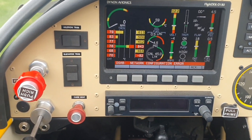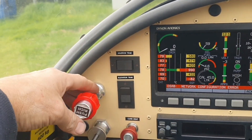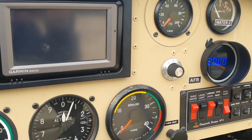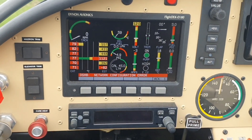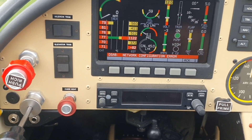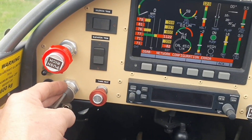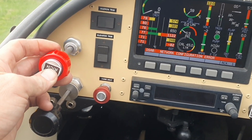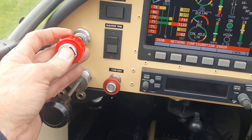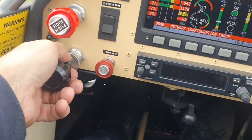That was all good. I find that at just about a centimetre or maybe 15 millimetres away from the firewall, at full throttle it gives us about 13 to 13.5 to 1 on the air fuel ratio, and that gives us best performance. Any leaner than that and it droops a little, any richer and it droops a little. Through the mid-range it's a little bit richer but once you settle into cruise you can start to lean it off and fly with best cruise. Through the transition it'll be rich but you're mainly interested in performance at full power.